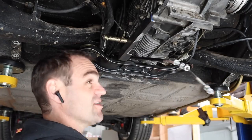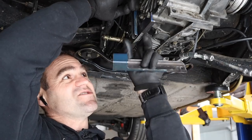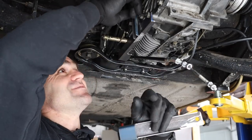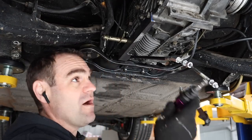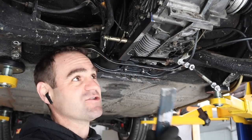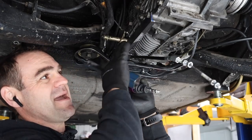Now I'm going to have an extra brace that's going to bolt on the side here that I'll weld together so this is all nice and structurally solid. It's not just held on by one bolting spot. It'll be on three bolting spots, nice and solid, for my slave cylinder. I went through all the effort of building this whole bracket contraption thing and it's too short, so I had to make another one up out of a piece of angle.